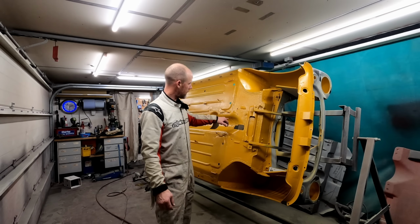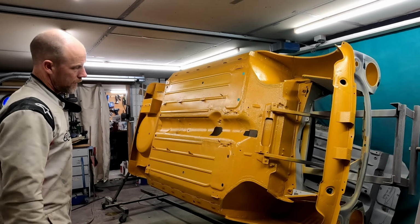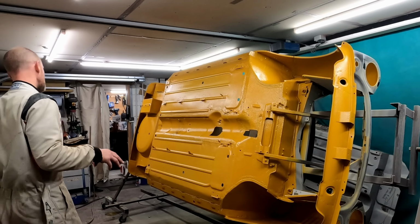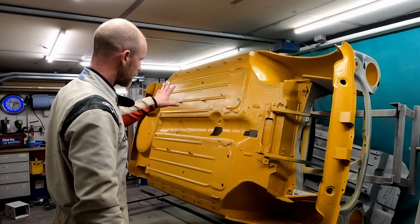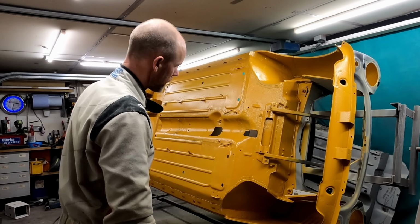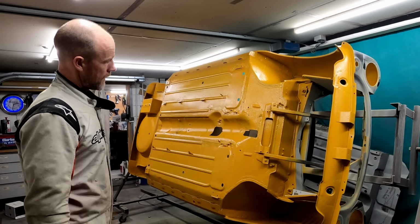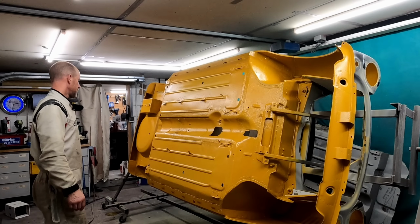I don't know whether you can see now. You can see where the seam sealer is obviously darker than the primer underneath. So I'm hoping, because it's still obviously green, that it's going to go back. Now I did have enough to put a bit more on areas you might see, like in the wheel arches and stuff like that, but I'm hoping it's just once it cures, it's just gonna go away, if you like. So if it doesn't, then on the next one, if I do use that, I'll probably go through the process of priming, seam sealing, then priming again, and then putting the Stonechip on. Yeah, it's covered all right, I suppose.